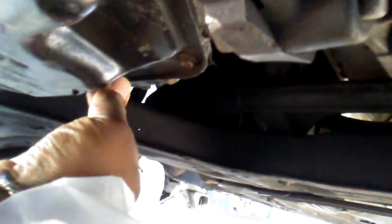This is the oil plug. So you have to use this — I'm gonna show you — to start leaking the oil. This is the oil plug. You have to use this like a 13 millimeter wrench and turn it to the side to loosen it.